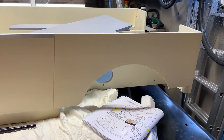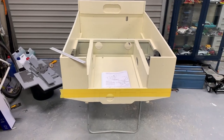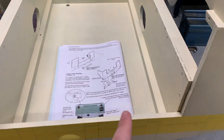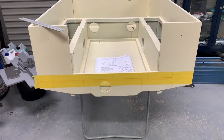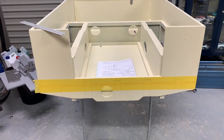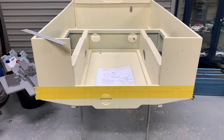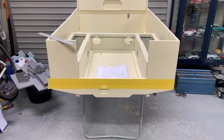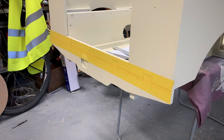After a bit of a garage re-juggle with the Land Rover moved out, I've taped up the area of the rear cross member on the Toylander. Using measurements from the Toylander instructions, I've marked out the outline of the rear cross member and the five little body tabs that hold the rear tub onto the chassis. Now I'm going to use a knife to cut the tape at those points, then sand down where I'll be painting silver, mask up the rest, and give it a blow-over of silver. I've gone along the outline with a Stanley blade and a ruler to keep it straight, and now I'm going to peel the tape off.